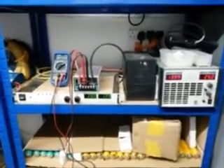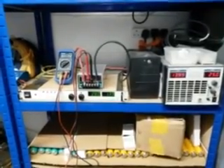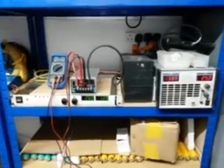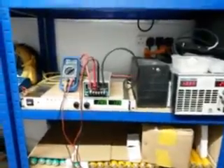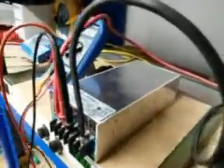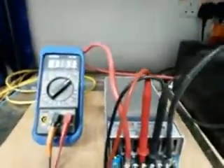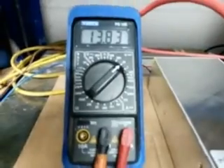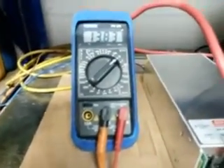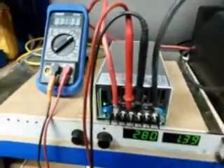I'll try to capture this testing of the PSU which I intend to use for the MDM removal and replacement for the IMA system, so you have a basic alternator function. We've got the PSU here on top of my high voltage power supply. The inputs are at the back for the high voltage and the low voltage output is at the front. I've adjusted it down to 13.8 volts. This is a 15 volt 43 amp supply — looks like a genuine Meanwell, came in a nice box, got it from Mouser.